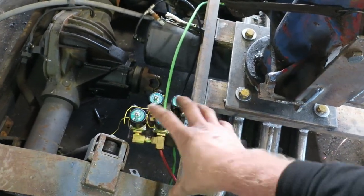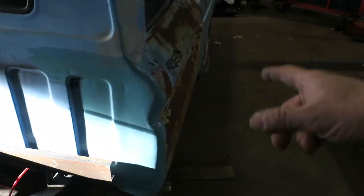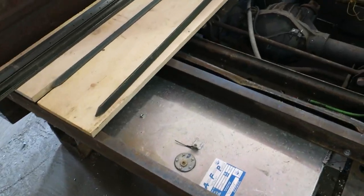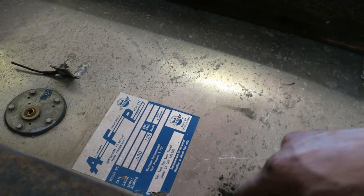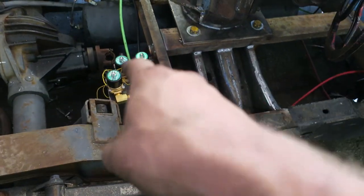If anyone knows of a home-built computer that can control all this — like a programmable module — I'd be interested. I just need to raise and lower on the valves briefly to measure my tire clearances and order rims. With the FAST system roughly mounted, I bolted the fuel tank to the frame and welded it along the top. Don't recommend welding fuel tanks — this one's been empty for years and I filled it with water first, but fuel absorbs into steel and can still be flammable.